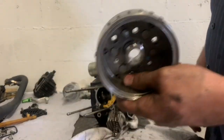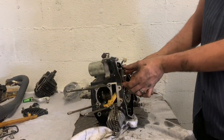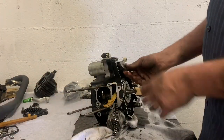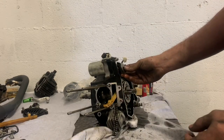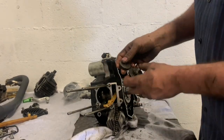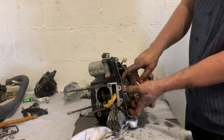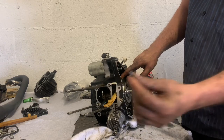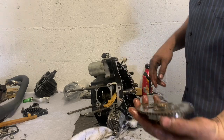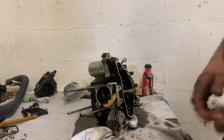It was a little tighter than I thought — I remember it being a pain to pull loose, but there it is. Pull that off and set it over here. Now get your starter gear off — I've done pulled that one off. The line goes inwards, right there on the ring. Pull my half-moon key. Now I'll spray the one-way clutch out.